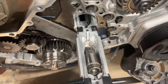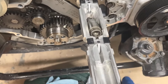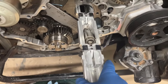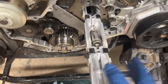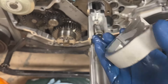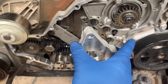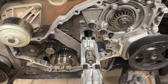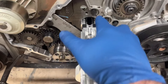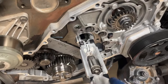Push the tool in completely until it stops. There is a block — it goes like this — and you use the two bolts supplied with the kit. What this does is it prevents the tool from rotating, because if you accidentally rotate the tool you can drop the lifters.